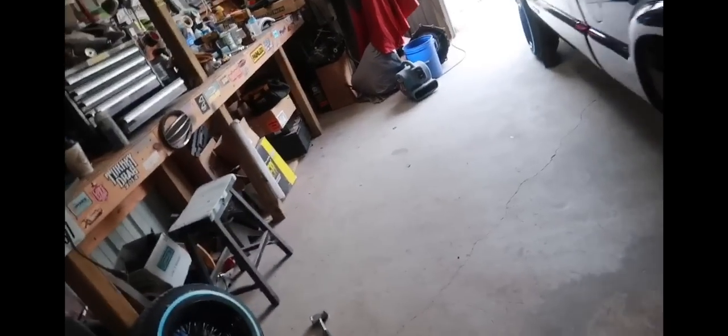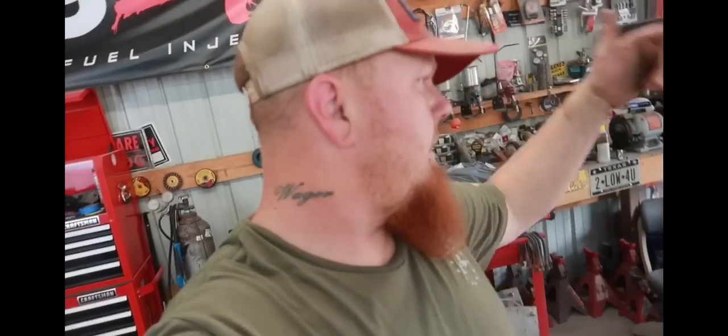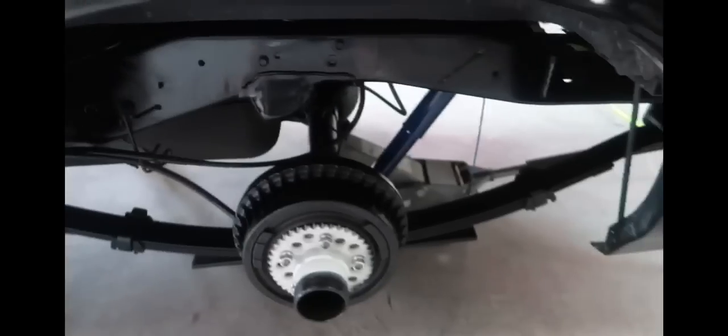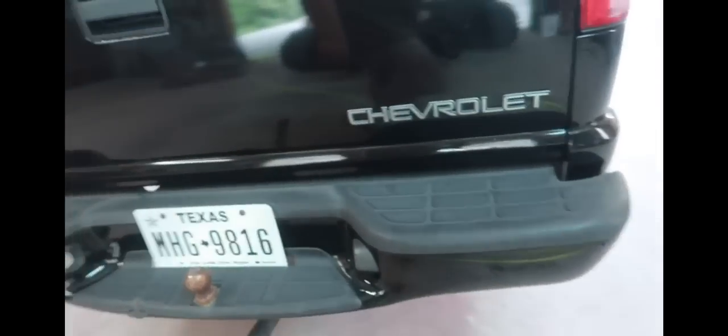With the little 13x7s on, I don't know what I'm gonna do with the front - might try to raise this side up just a little bit because it's sagging. We'll see when we get the kit on there, then get all that cleaned up, turn it around, get the nose faced in here and start getting the new grill, headlights, and bumper on. Got the frame painted - just hit it with a rattle can, little semi-gloss black, good to go. Got the rotors taped off, shocks taped up. We're gonna get the wheels back on this bad boy.